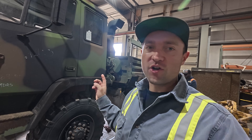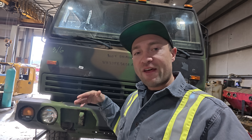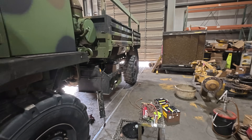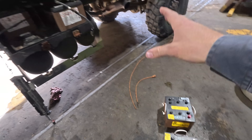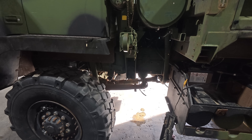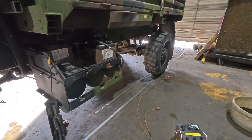So I mentioned in our last video that we have an overcharging problem with the truck. It runs right about 30 to 31 volts. It's a 28-volt alternator, but it has a 14-volt regulator on top that'll bring the voltage back down if you're running a 12-volt system. Currently we only have two batteries in here. My theory is that without having the two other batteries in place, the alternator is basically going to full voltage because there's nowhere for it to go. It needs four batteries anyway, so we have nothing to lose.